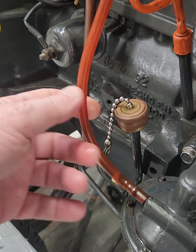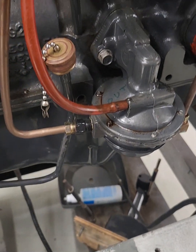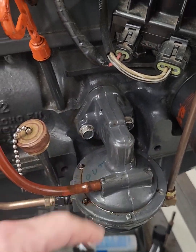Also, if any alcohol-related fuel gets in here, that's going to deteriorate the hose, which usually means the pump is no good anymore. These pumps have really become NLA — no longer available — so you really need to start thinking about changing over to an electric pump with a block-off plate.